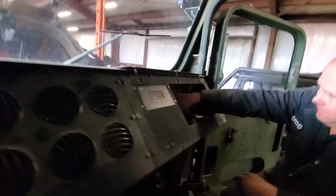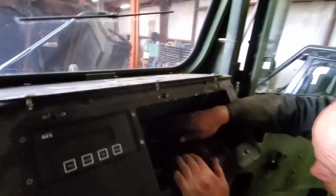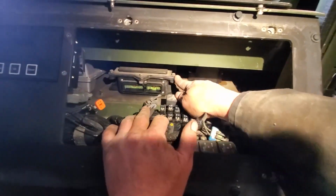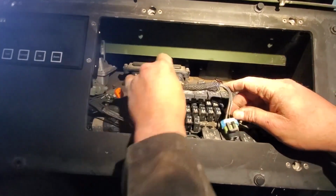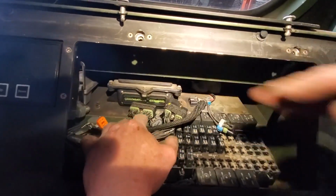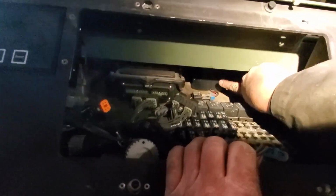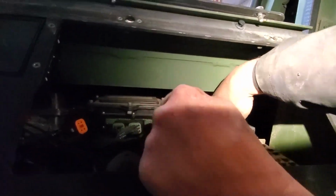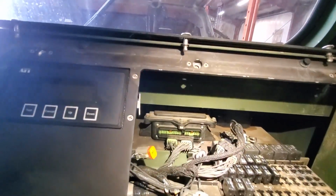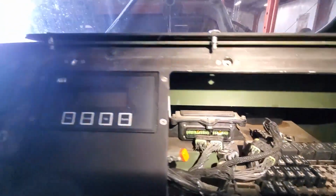Now it's the right outside of the truck, correct? Or is there more? More. Oh, good lord. Right here, flashlight, folks, is another interface module. There are 2 connectors on it. Quarter inch drive, we'll remove these. This is your electronic flasher unit, and it's a simple weather pack connector. Disconnect that. Now, there's the transmission controls and some of the other stuff. It's all listed on the placard, folks, but there's a lot. I'll be on the other side, sorry about the jumping around here. It's just a big truck.